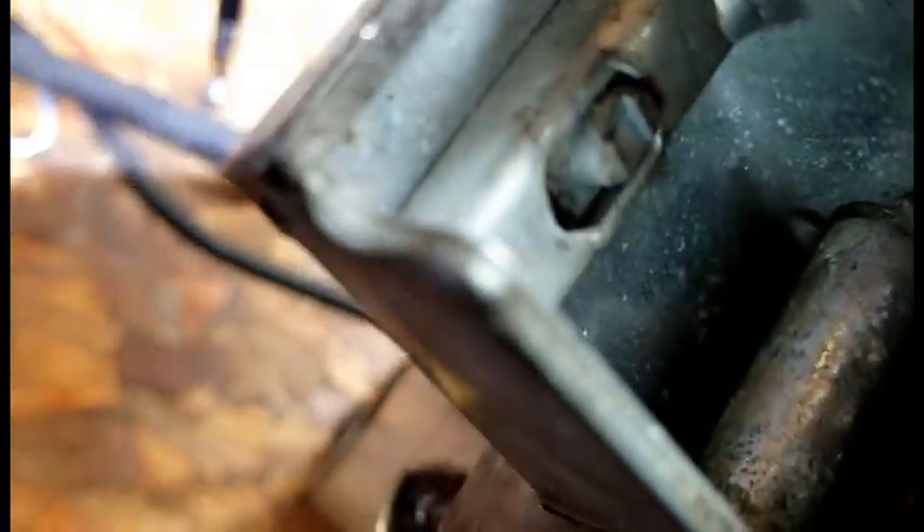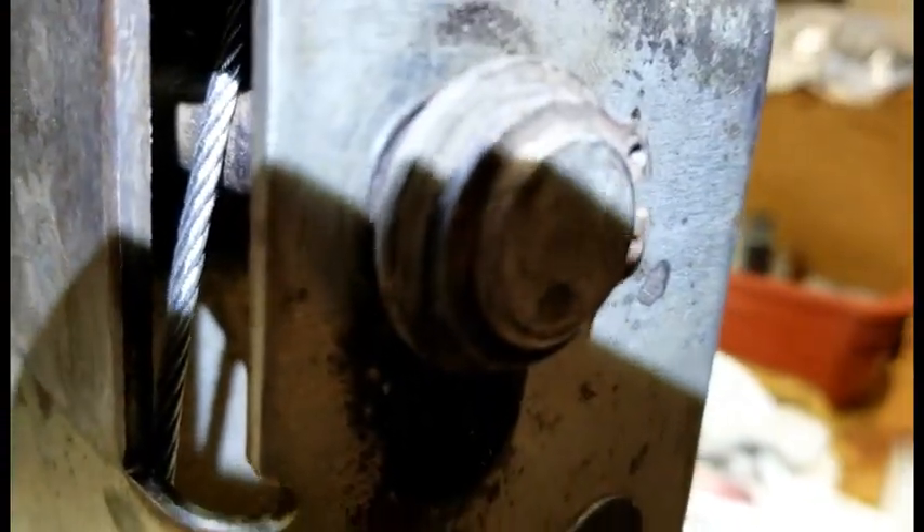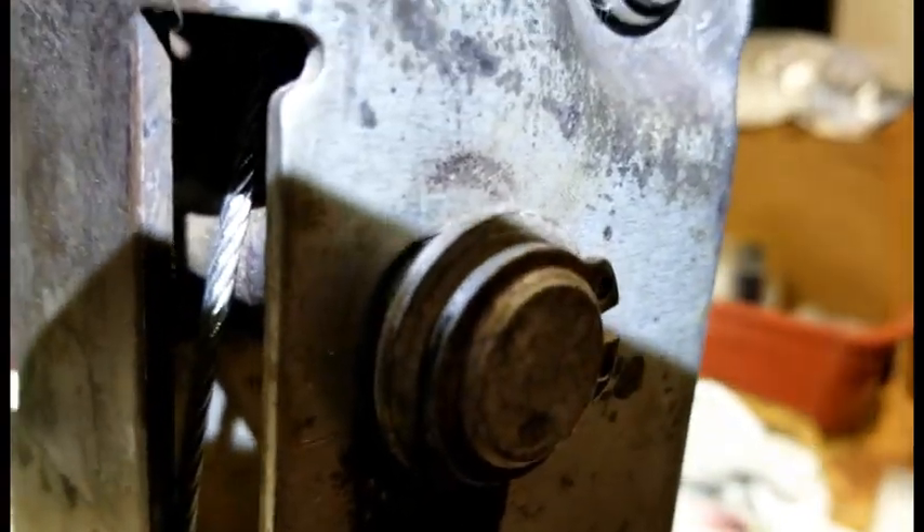The cable needs to go through the hole right here and then down through these two rollers or pins. There's a little tab down inside — you just need to go on one side of that, probably the left-hand side, the same as the hole. When it goes down past that, there's a pin on the side and you have to get your cable down past this pin, and on top of this roller, and then it'll feed down into the bottom. We'll flip the unit over and I'll show you how it attaches on the inside.